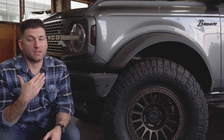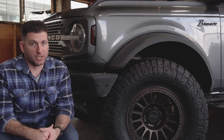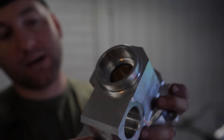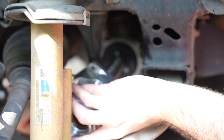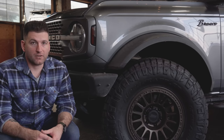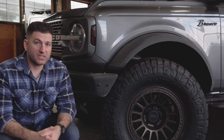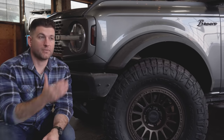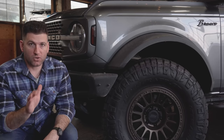Otherwise you risk breaking your steering rack itself, and that is not a fun or cheap replacement. The end cap is CNC'd out of 6061 aluminum and the installation is really straightforward — I did it in my driveway without having to take the steering rack out. The Icon tie rods are 30% thicker than the stock tie rods, constructed out of forged steel, and they have greasable Zerk fittings. Excellent tie rod for a great price — those sit around $400. The end cap is a bit more expensive at $1,000, but that thing is never going to fail you.